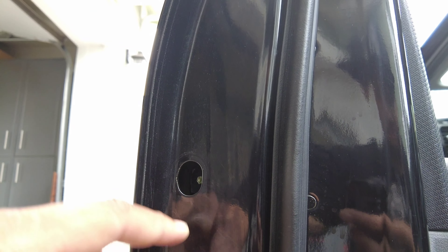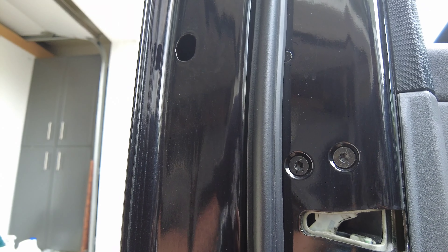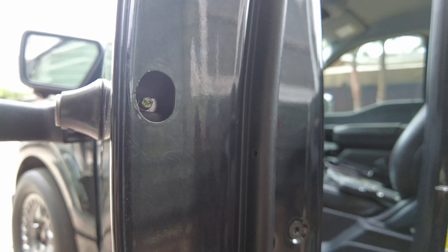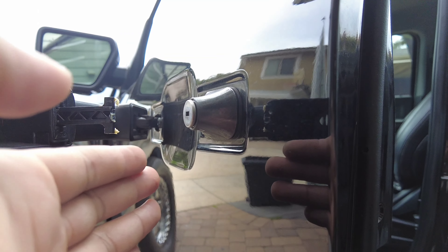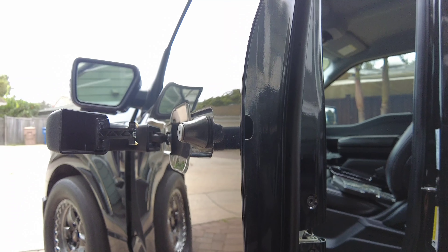You can see this little hole here — there's a little cover over it. Done a lot of these at the dealership, it's pretty simple. You can see how the mechanism works. What you're going to do is back out the little hex head right there. When you back that out, you want to put some pressure on it, pulling it outward, and it should slowly start coming out. Pretty simple, pretty straightforward, really basic.